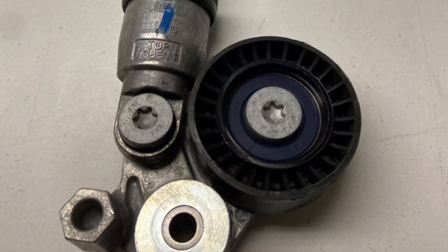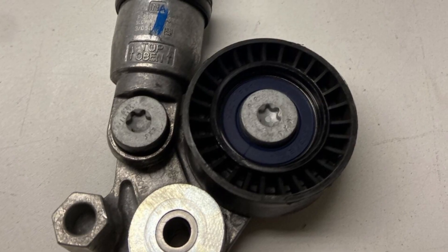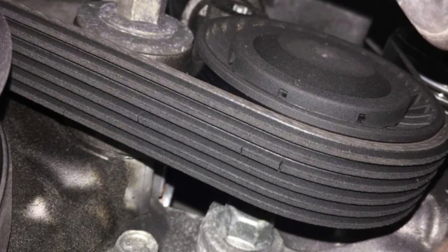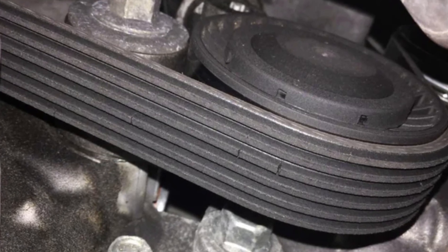It's a good idea to inspect the drive belt system from time to time. The drive belt has a tensioner with a plastic roller, and it's not uncommon for these rollers to develop tiny cracks and eventually kill the belt. This won't lead to major engine damage, but it may leave you stranded since the battery will die almost immediately when this happens and you won't be able to drive your car.